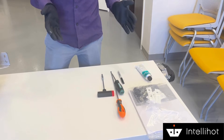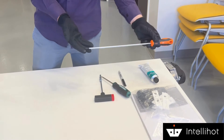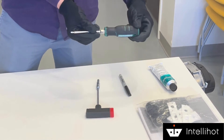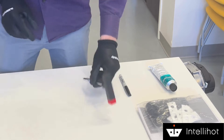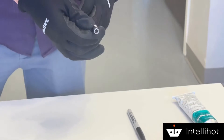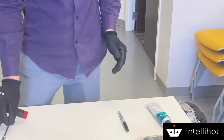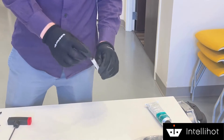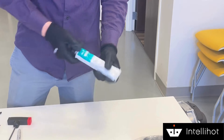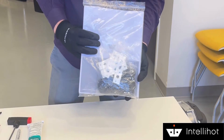Before we start, let's talk about what we need. We're going to take a long Phillips head screwdriver — it's long for a reason, we'll talk about that. We're going to take a T20 Torx screwdriver. And then you really need a five and a half millimeter socket head, which is what's going to allow us to get that top cast plate off. I like to put it on a T handle because it allows us to access what we need a little bit better. A couple extra things: we're going to have a Sharpie marker, we're going to use Molykote Compound 111, which is a lubricant, and I'm also going to grab the accessory bag from inside our front door.